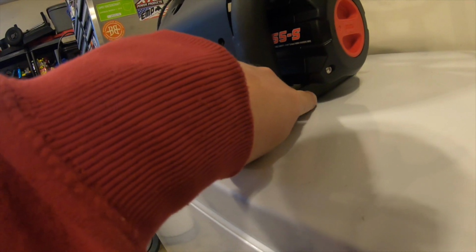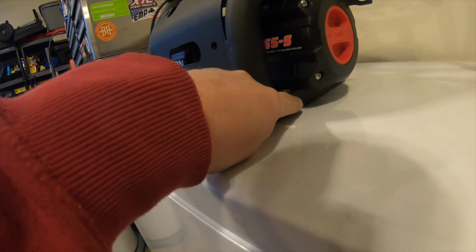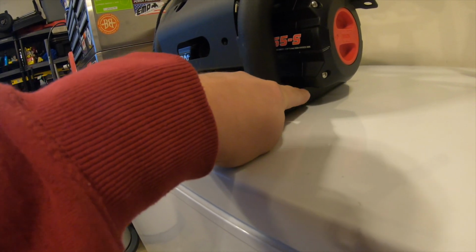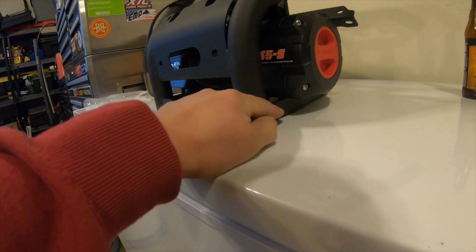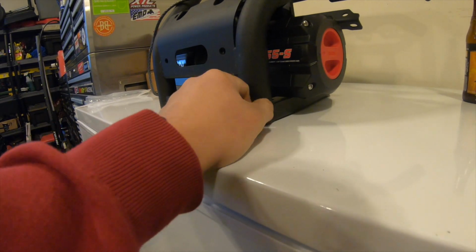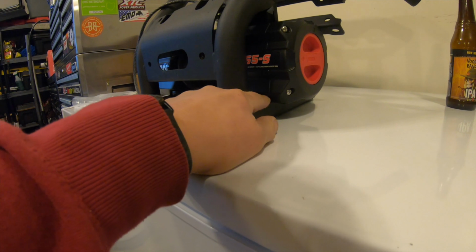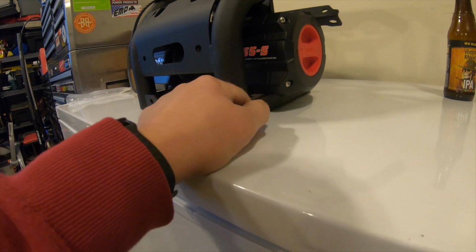So it's like this area, like right in here. So some of that might end up getting trimmed, but I'd rather see spacers so that we keep the integral part, like the side here, intact, because that's your strength, especially of your bulkhead. So I'd rather keep that intact and just use some longer bolts with some washers.